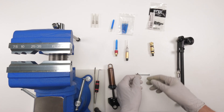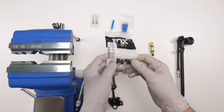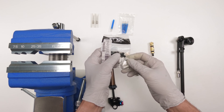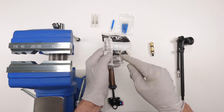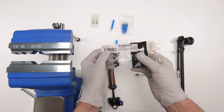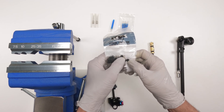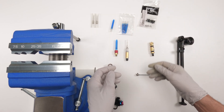You want to make sure you have a backup for when it breaks. Another thing you're going to want is extra pellets. Sure, your damper body rebuild kit comes with a pellet, but if those needles break you can only use these pellets so many times — no more than three personally, and after two times you're taking a risk in my opinion. You can buy these individually for about one to two dollars each. I would have four or five on hand, or you could buy a 50-pack — part number 803-01-651.